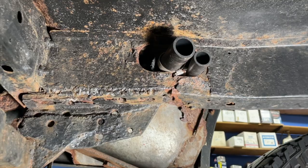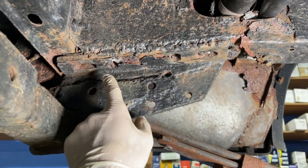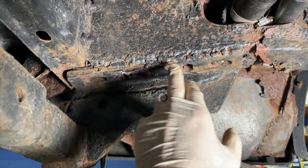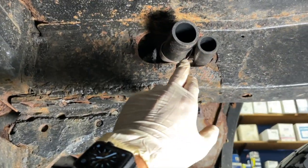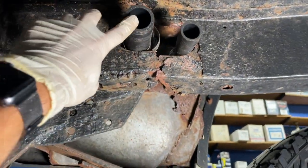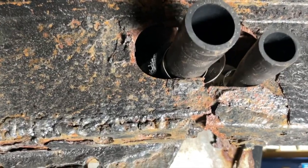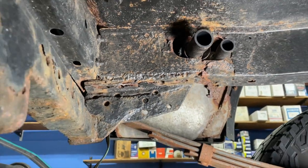of the car. This is when you know the trailer hitch is bad. It should be bolted here in some of these spots, but whoever installed it realized that the threads were bad, so they just welded it up top here. And this is junk. But what's even worse is that it's cutting into my gas line area. This is where the gas line comes through and connects to the gas tank. That whole wiggle, that's not supposed to happen. That's just me pulling on the trailer hitch.